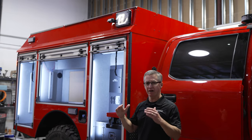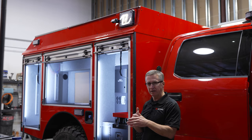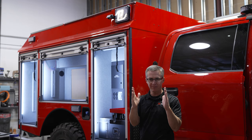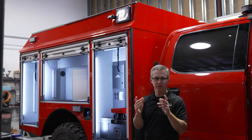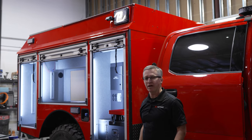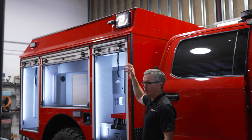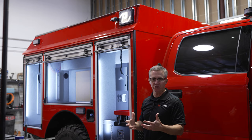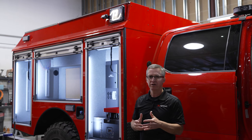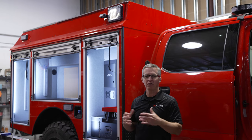The last video we made, we didn't have the external fascia on. Now we've got the top storage boxes and a three-piece fascia that's painted. We built some flanges on the aluminum to kick the scene lights out vertically — they're also 13-degree down optics, providing a tremendous amount of light. The fascia is modular rather than built into the body, so if something gets damaged or a customer wants to change it, we can move pieces without having to tear the whole truck apart.